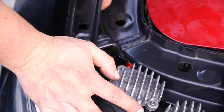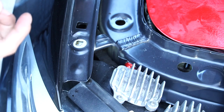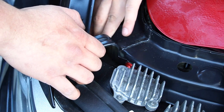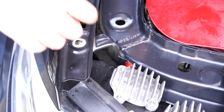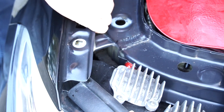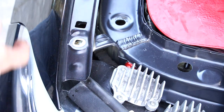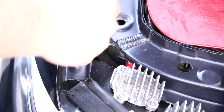Our first one's done. Now here's a tip I just discovered — these fender clips will also have to come off. They're the ones that hold the fender in place. I found that you can take this off and pull it back slightly to give you more space to work in here for the bolts going on the side of the chassis. It really did make it a lot easier to remove and put them in. If you have big hands like me, this is going to be especially helpful. Alternatively you could remove the headlights, but that requires a lot more work, so we're just going to do it like this.